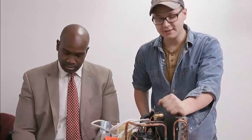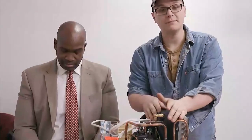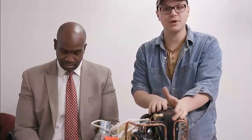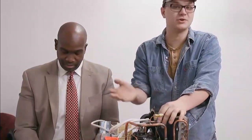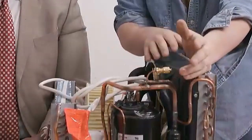So every week we're going to do a different project. These units don't come from the factory with service ports at all — they come just with hard pipe, so you really can't service them when they go bad. You normally just junk them, but we want to make it a little bit better. We're going to put in two service ports. The first step is to recover all the gas, and we're going to put a piercing valve on it to give us the potential to recover all the gas.